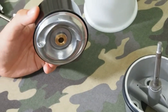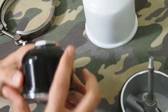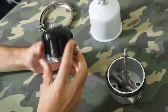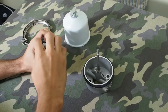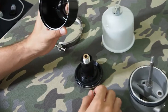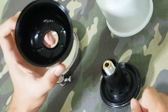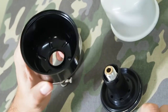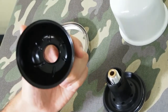What's different about this particular centrifuge compared to many others that were factory fitted is that there are no consumables in this device. This doesn't need to be replaced — it comes apart and you can clean it. All you need to do is undo the top piece, and this is where all the dirt or soot would collect inside. If you have this centrifuge fitted to a vehicle, it's just a matter of removing this, cleaning it out, and putting it back together.